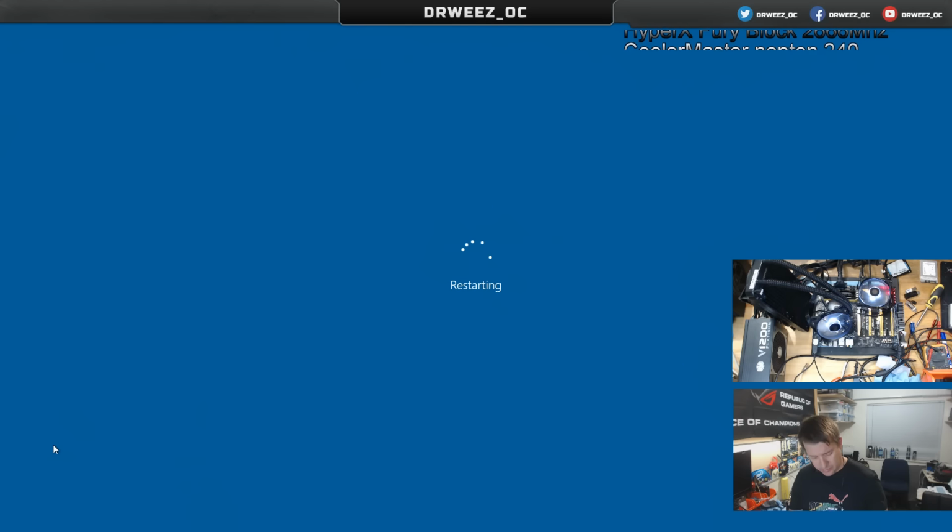Now for XTU, and this is a real tip that most people won't give out, there are two timings that are really quite important, or three timings to be precise. There's your TFAW, which needs to be as low as possible, and then your TWRWRDR and TWRWRDD, DR and DD, these two here. Those two are very important for XTU as well.